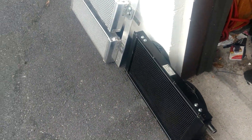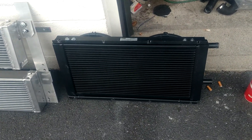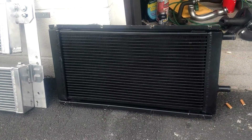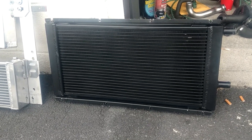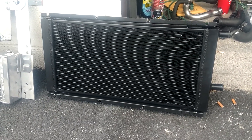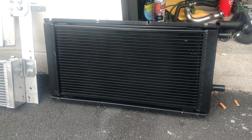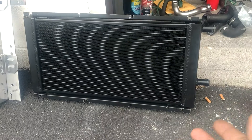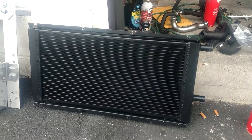Getting the air out, getting the flow, heat soak — this was the first one. I've got two intercoolers, not just one. I went with what I thought was a big single intercooler to do the job, but it turns out I was getting heat soak, probably due to the fact that there might have been only about a gallon and a half of water in the system. I ended up having to run the two intercoolers in series rather than parallel, because what's the point of running in parallel when you only have a single flow through the heat exchanger.